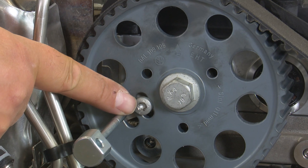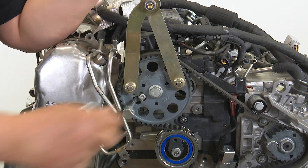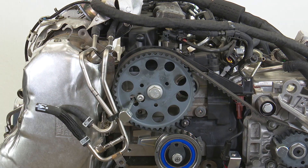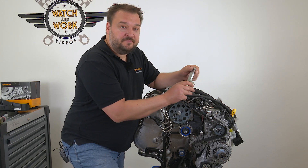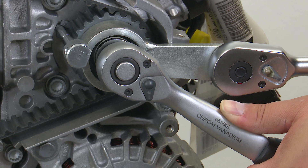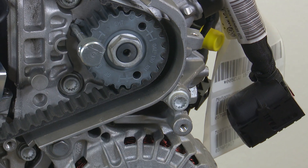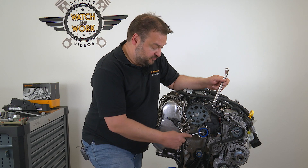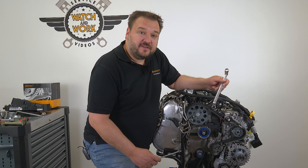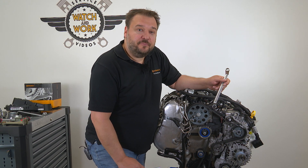The next thing to do is loosen this bolt and then the camshaft's central bolt with the help of the counter hold tool, as well as the nut on the high pressure fuel pump using the special holding tool. You now loosen the tensioner pulley's bolt, release the tension in the eccentric cam and remove the timing belt, after which you can replace the components.